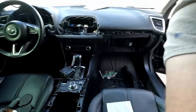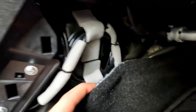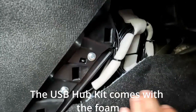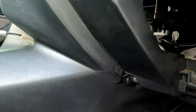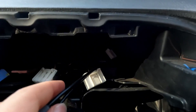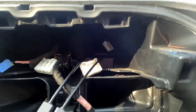Let me show you the wiring. It's plugged in here, ran through here, made a little loop, covered up with some foam, and zip-tied. I used the same foam to stick it to this plastic right here, then shoved it under the carpet so the kick panel will sit in there nicely. I fished it through here with the kick panel off, through this hole — you can feel it poke with your fingers once you're actually doing it. You'll know exactly where precisely when you get to it.